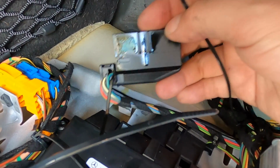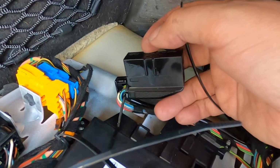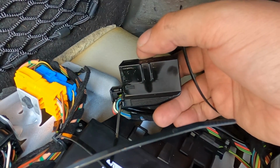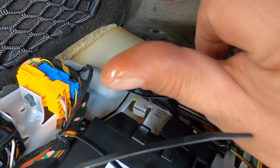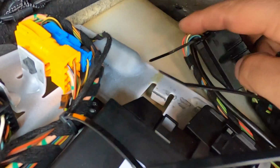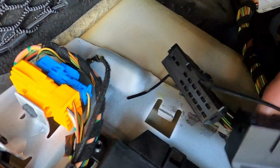That is very common with the Crossfire. It's common with the 722.6. When that connector O-ring goes bad, it actually shoots transmission fluid through the wire looms, and right there you go. That is transmission fluid in there, and you can see some right there as well. We do have transmission fluid.